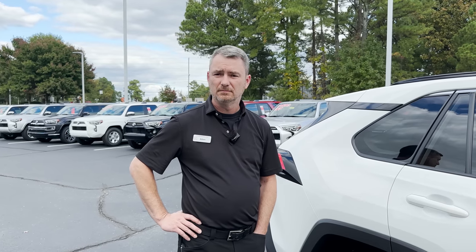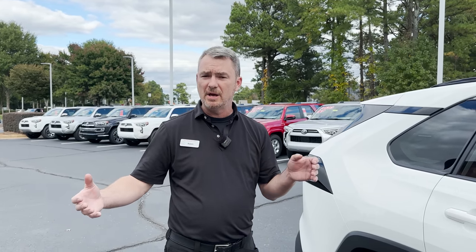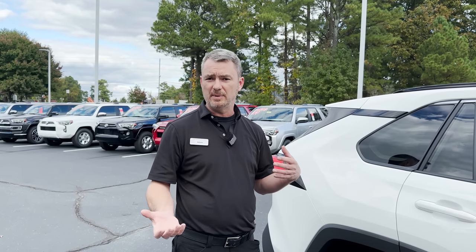What would somebody spend ballpark to replace a battery pack including labor on a Prius? On the older Priuses, say Gen 2, I would expect the cost to be in the neighborhood of $5,000 for a full battery pack replacement. You have to take the battery out and tear it down a good bit — the bus bars have to be exchanged over and the HV control units all have to be transferred onto the new battery. So there is a little bit of invasive procedure involved there.